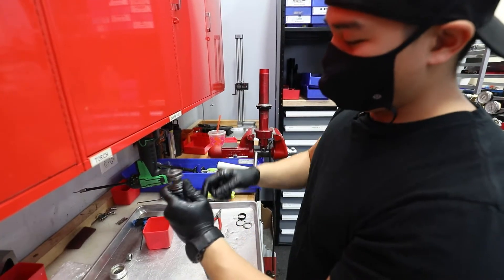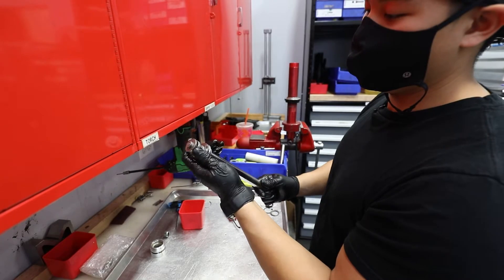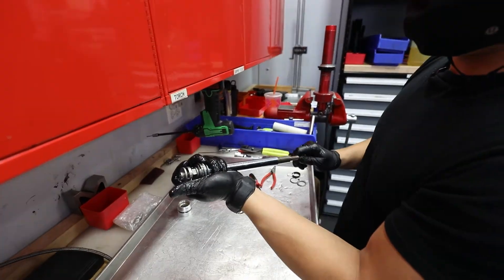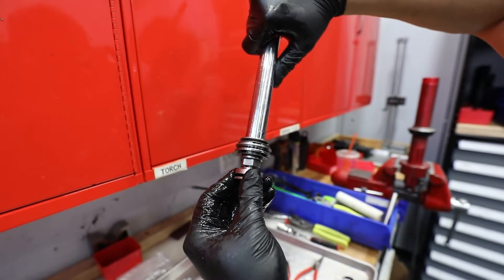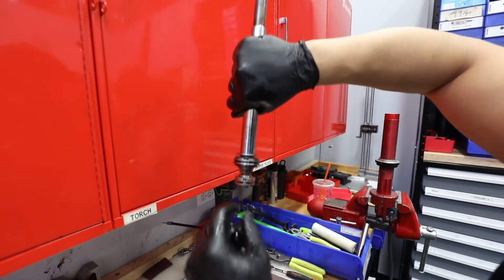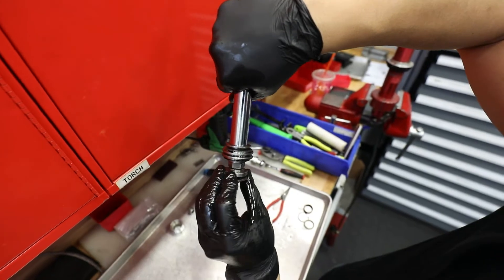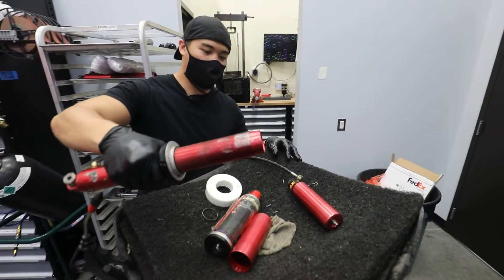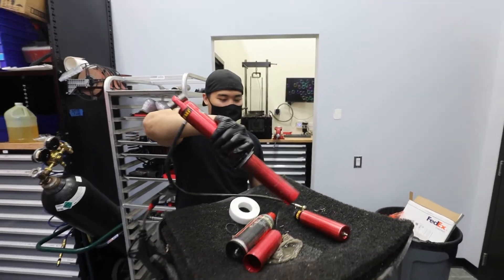Normally, when you turn the rebound rod - you see that turning? When it's not broken, it would be in the groove for this nut for rebound. On the rod, there's a bunch of little holes drilled, and that controls the flow of fluid for rebound. As the piston rod's going back up through the shock, all the fluid's going in through these holes, going into a manifold, and then the flow of that fluid is controlled by turning this nut and closing all these little holes on the bottom of the piston rod. Come over here, dump it all out. That's some pretty clean fluid for these really old shocks.